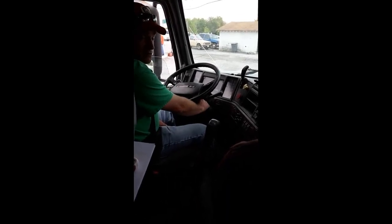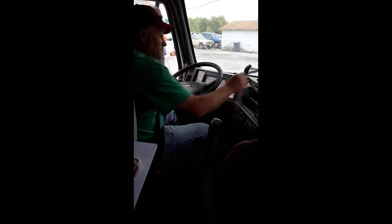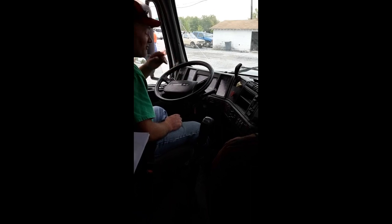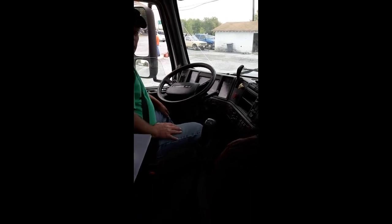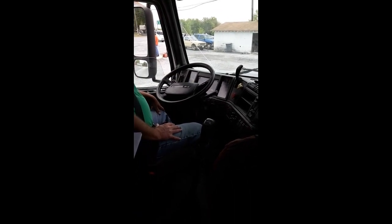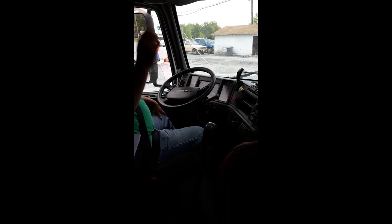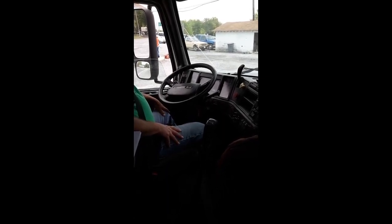Switch back on, two clicks. You'll see the dash lights open up. First step of the lab is what? 90 pounds of pressure. For how long? 60 seconds. What am I looking for? No more than 4 pounds of pressure. All right. There we go. No more than 4 PSI.